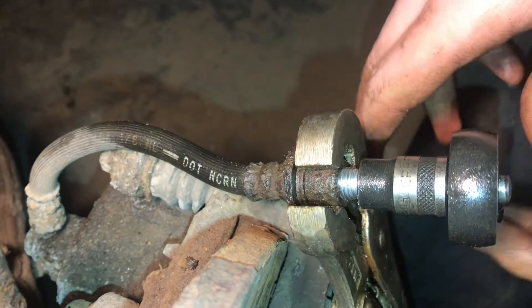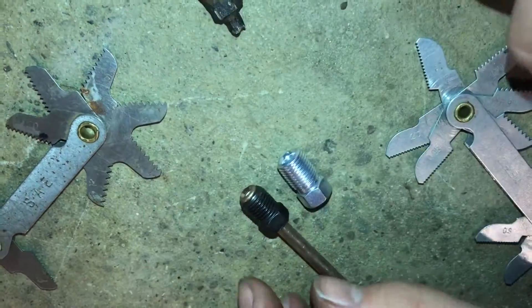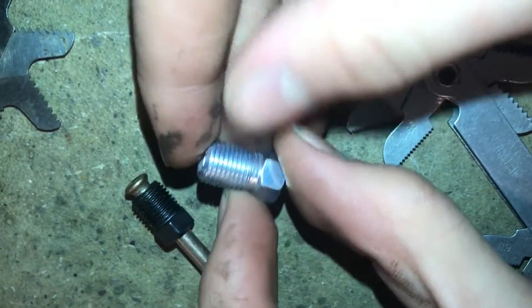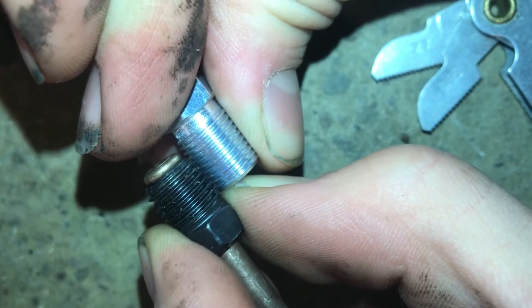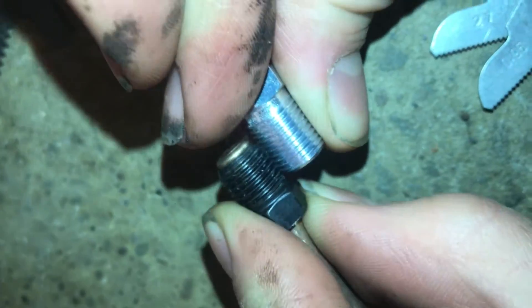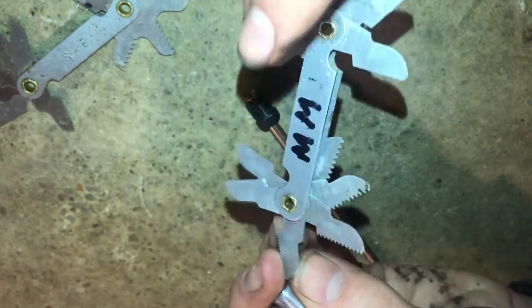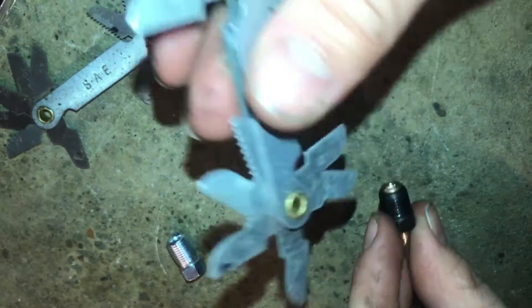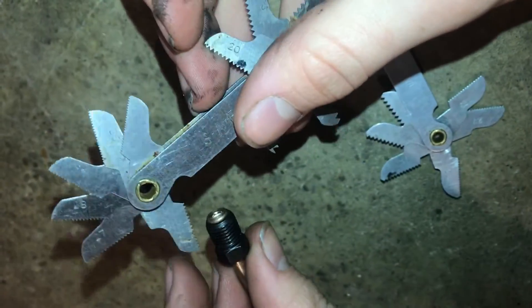It needs to really press firmly against that double flare. If you get your brake line — they normally have fittings on here — and you compare it to your old fitting and find one that looks like it'll fit, it looks like the right size, it looks like the threads will mesh. This fitting here is the correct size and has cleaner threads, so it looks like it'll fit. But if you look closer at the threads, they aren't meshing perfectly. If we take it to this thread gauge — this is a millimeter thread gauge — you can see it fits perfectly into the 1.0, so this is a 1.0 pitch.